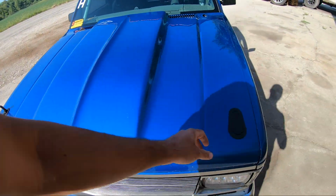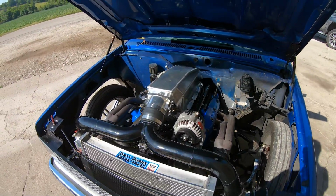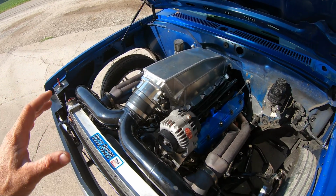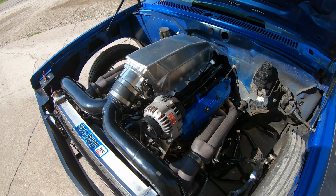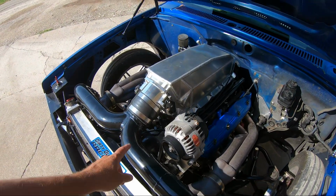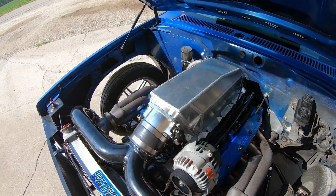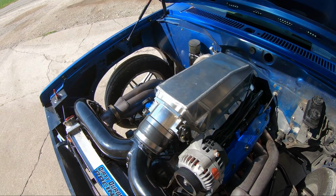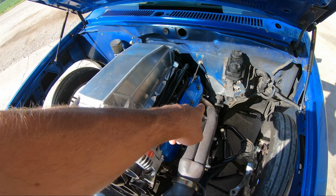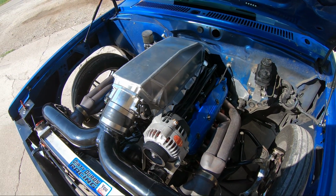We put those valve springs in. I think it fixed a little issue up top on the RPM side, but it still has a weird boost flutter type of situation. So I'm gonna change the plugs in this thing, and I'm probably gonna use my little fancy smoke machine and smoke out the intake system just to make sure I don't have any boost leaks. Or maybe I might do exhaust as well. Maybe I still have exhaust leaks. So I can do that real quick here at my shop.